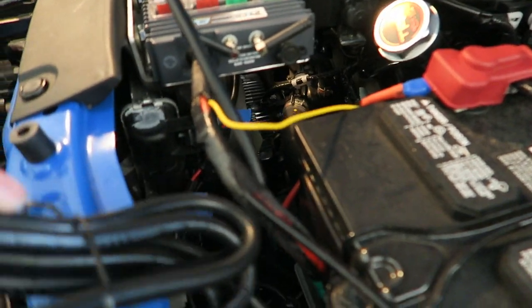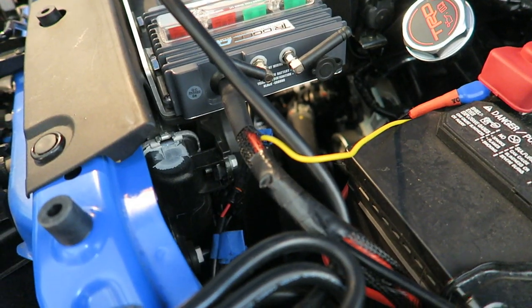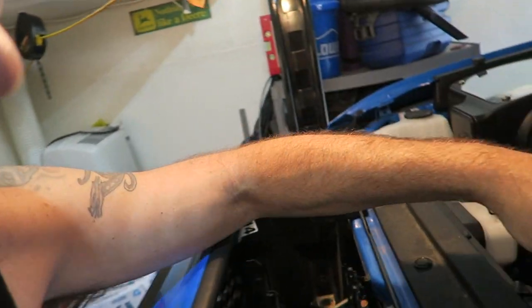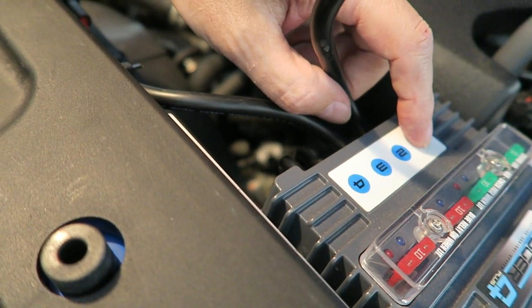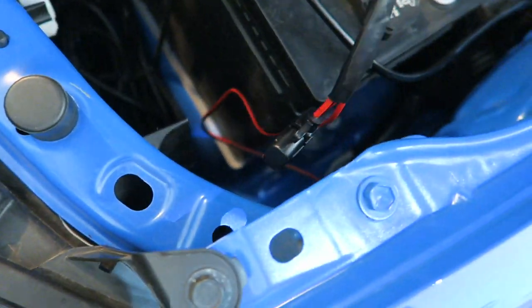I'm going to bring the wire through this hole, which will drop it right where I need it — perfect. Got everything wired up to my switch. This is just a part that comes with my switch. If you don't have the switch, you'd go a different route like that little plunger thing. Because I don't have constant power to that switch, the light won't come on unless I have the ignition on or in accessories mode. I hooked it up to number one — easiest to route the wire. I went ahead and put the fuse in, it's right down here.